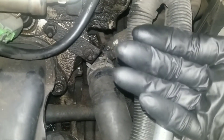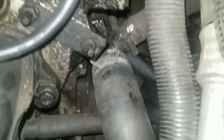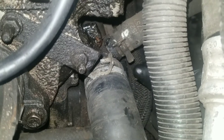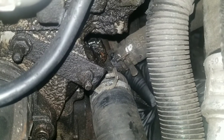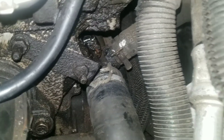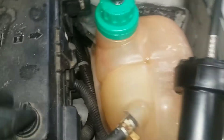After wiping it off, I make sure my glove is dry and I'm feeling on the very end of the hose to see if there's any coolant — nothing. I'll keep an eye on that anyway. This hose right here runs back to the bottom of the reservoir tank, so I'm going to try to get under there — you can see the clamp right there.